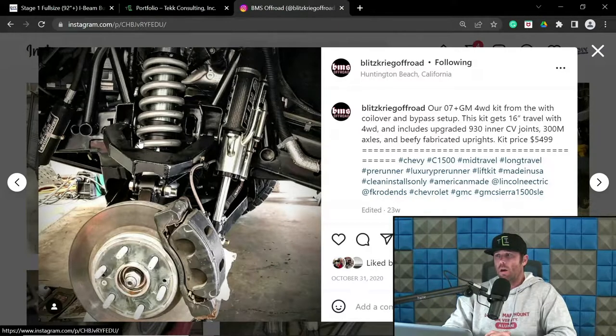I think basically what they're trying to do, typically speaking, when they start pushing stuff up that wide, and you guys know who you are that have done it, I don't want to be offensive by any means, but it's too much, man. I would much rather be in the ballpark of 16 inches of well-controlled wheel travel, maybe 17 at a 94, 95, as opposed to pushing it to 98, 100, 102, just to gain like 2 more inches of wheel travel.